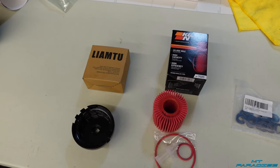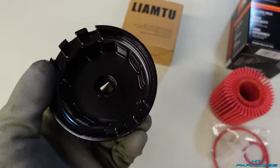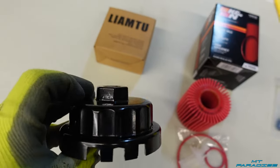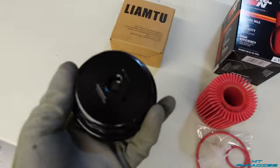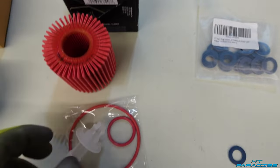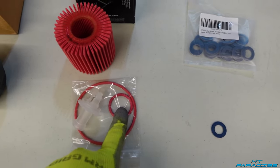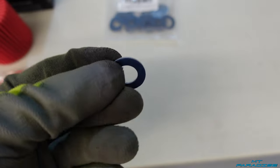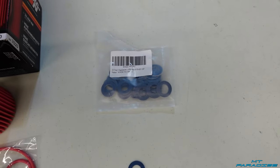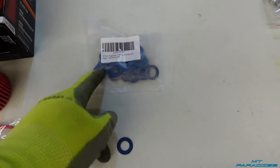There's going to be a few tools that you're going to need, such as this oil filter housing removal tool — this is actually super cheap on Amazon. There will be links in the description down below for all these tools. You can pick up this oil filter housing removal tool, which just uses a simple socket set. Then there's the K&N oil filter — it does come with a little tool to drain the oil out of your filter housing, and obviously two o-rings and a crush washer. This is pretty much the exact same type as from the dealership, however also available on Amazon in a 24-pack for like seven or eight bucks. You will need a new one every time you do an oil change, so just go ahead and pick up the whole bag of them.